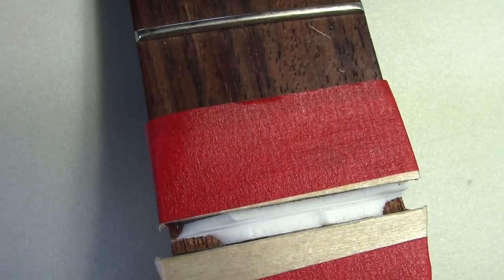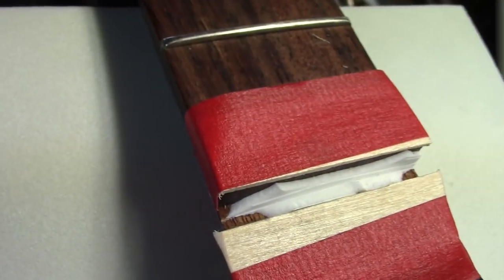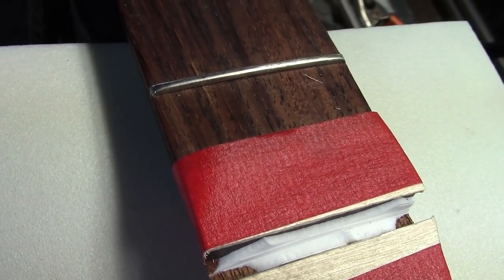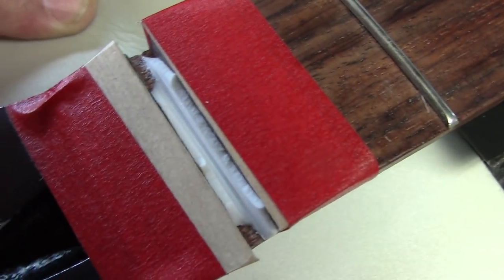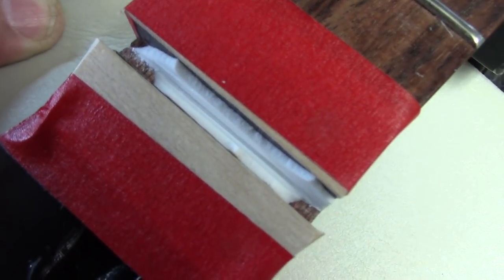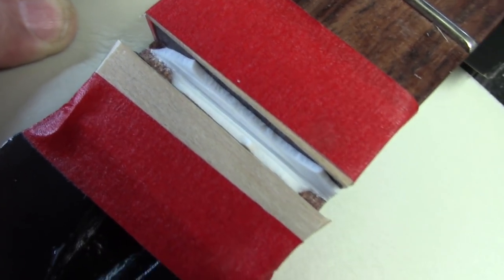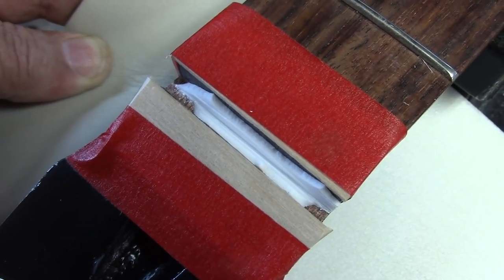Here's our bird's eye view of what we've got so far. I'm going to need to score down this to center mass of what's left of that nut, reheat it, and ease it out nice and gently. This is a huge opportunity for both my students and my subscribers that do this type of work. This is the worst case scenario nut, where it breaks off like that, comes out in pieces. But if you look closely, we are right on the glue joint. Now we'll reheat again for another 4 minutes.